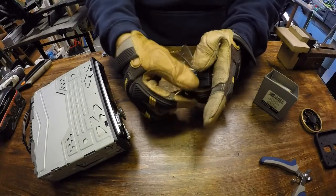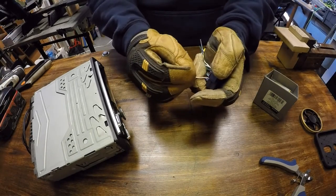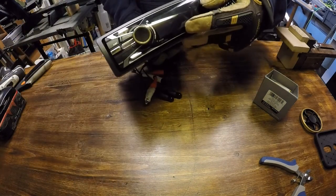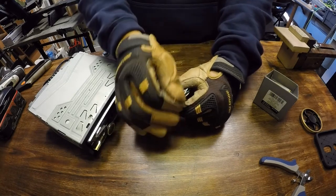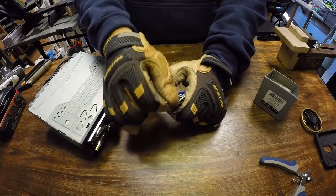The orange with the white stripe is your dimmer. So when you turn the headlights on in your car, this will activate and it will dim the face of the head unit. If you're not sure which one you have in the vehicle, just make sure to cap off this lead. This will pop fuses and cause a lot of issues if you don't hook up this wire correctly.